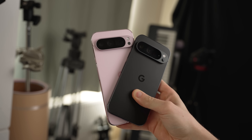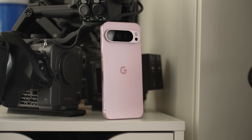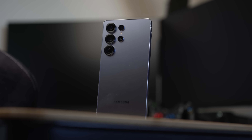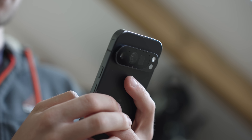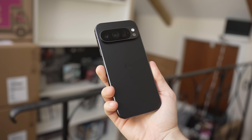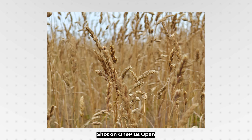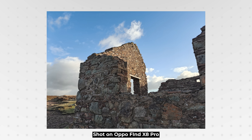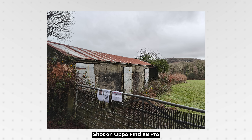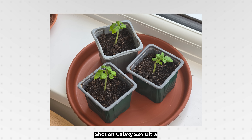There's more to it than sensor size. Most telephoto cameras are tiny — 1-over-2.55 inches, which is about the same size as the primary sensor in the original Google Pixel — but under a thick telephoto lens. A lot of these are five-times optical setups that can actually stretch quite comfortably to 10 times, sometimes even 15 times, before you start to get major image degradation, on sensors barely big enough to qualify as selfie sensors. We're currently at a point where 1-over-1.3 or thereabouts is as big as most mainstream manufacturers are wanting to put into their phones — likely to avoid a seriously huge camera bump, to cut down manufacturing costs, and because the general public find them more than good enough, thanks to computational photography outside of the RAW option that some enthusiasts choose to use.